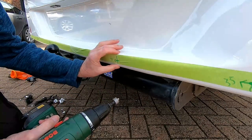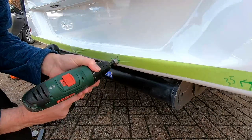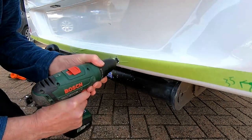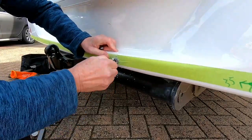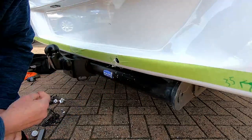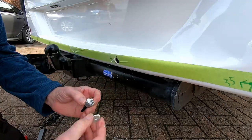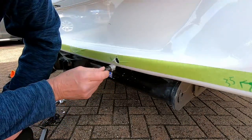So I've marked up, taken the width of that, found the center point. Here's the drill bit that comes with the kit. Cross fingers, good luck. Let's hope we haven't cracked anything. So what I'm going to do is get a file and smooth this edge off so the sensors fit in there quite nicely. There's obviously a bit of plastic there, so I need to be careful when I drill in - as you saw, I snatched a bit, so I need to go in very gently to get a grip.